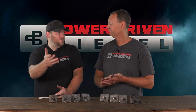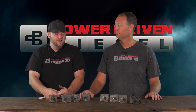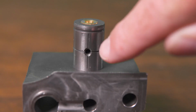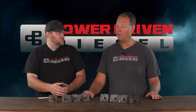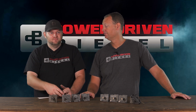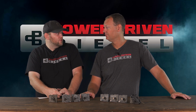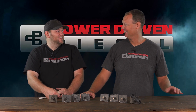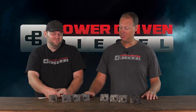If you haven't seen that video, the 4BT cylinder head test, we put this on the Koontz Boys 4BT, and you can see the oil. We have improved the oiling too. There are bigger oil passages in here, so you're getting more oil to the rocker arms, though not so much that you're going to cause low oil pressure. It's not close. Normal rocker arms take almost a minute before you get a lot of oil coming out. On theirs, after a minute of idling, that oil spattered all over the top of the engine. They said, oh, I guess we should put the valve covers on. Yep, because oiling is a big deal. It's the lifeblood of your engine.